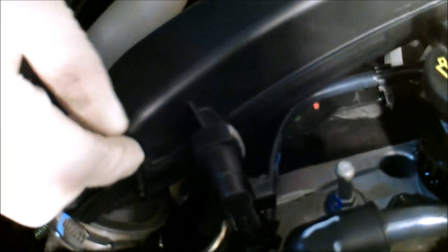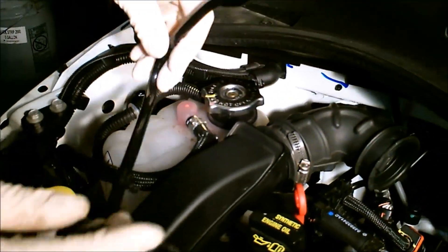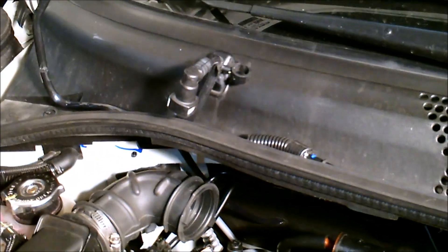This one traces over to the inlet tube. If you have an aftermarket intake, it'll go to the same one — it has a gray release tab. Push the gray release tab, pull it off, and this whole line will come off. There are some fittings and such, but for the ease of the video, we've already had everything pretty mocked up.